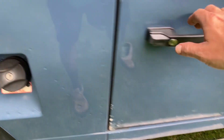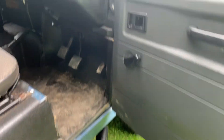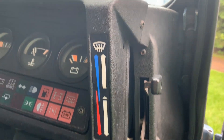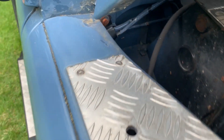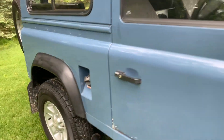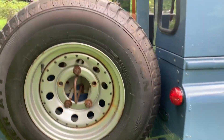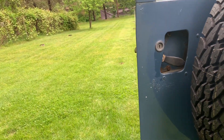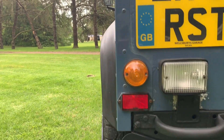The bottom of the door has corrosion on the driver side; passenger side is great. This one does have a little bit of rust in the corner and the bottom of the frame. Bulkhead on this side is great — there is no rust coming through. There is a little bit of corrosion on the hinges and a little bit of rust coming through on the footwells on the top, but the bottom and sides in front of the footwells are all in decent shape. We do have a little bit more paint chip on the top of the wheel arches. There is no corrosion on this capping — it's all nice and clean. A little paint chip and corrosion at the bottom of the door handle.